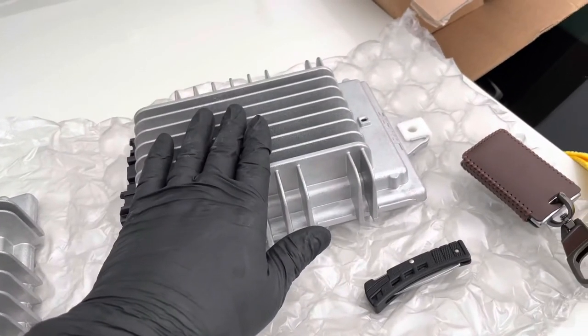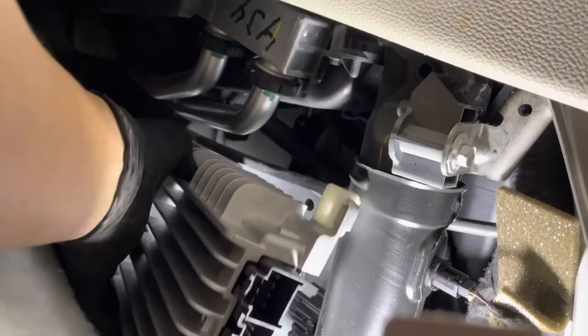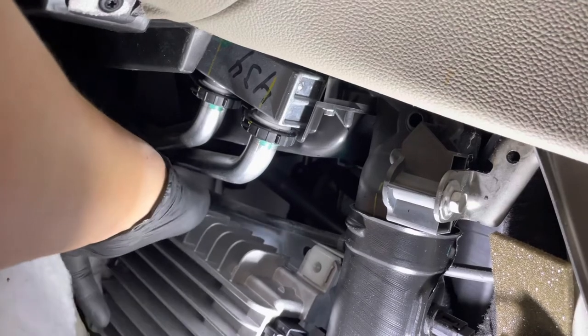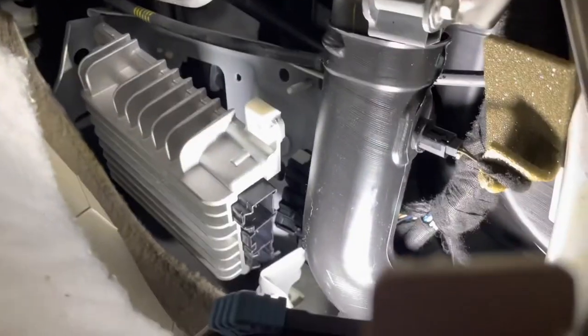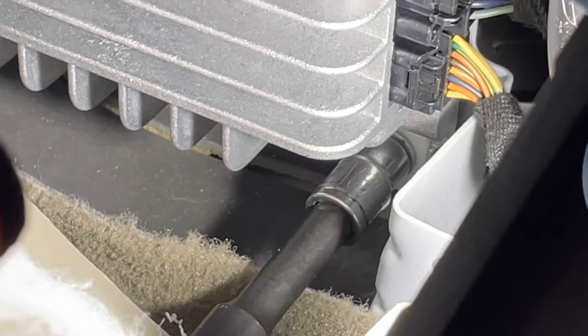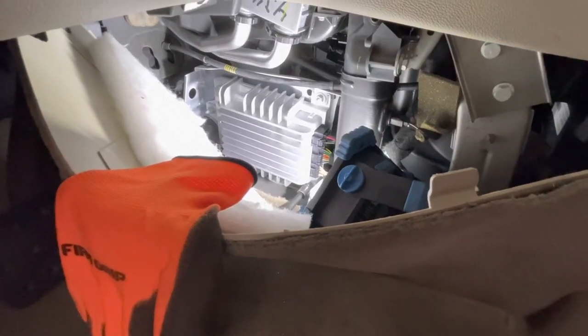So I'm just going to do a plug and play and put it back in the way I took it out. I'm going to wiggle that in. I'll put the top nut on first just so it can hold it in place, then put in the remaining ones. Just to give you an update — you see where my socket head is for that very bottom one? If you go in from the bottom, you'll have a lot more room so you don't have to struggle as much. Let me just make sure those harnesses are tight and then we'll turn it back on and see if that fixes the issue.